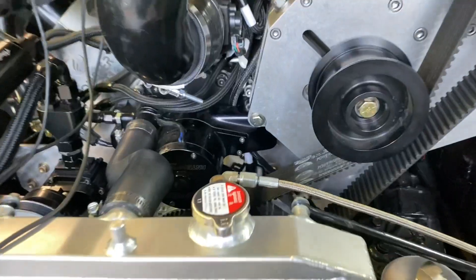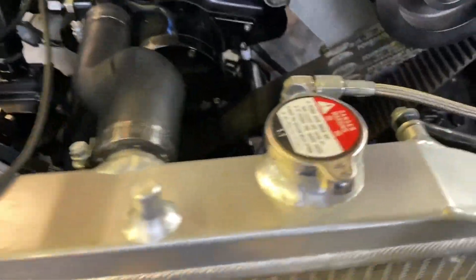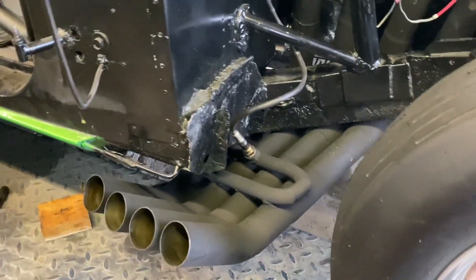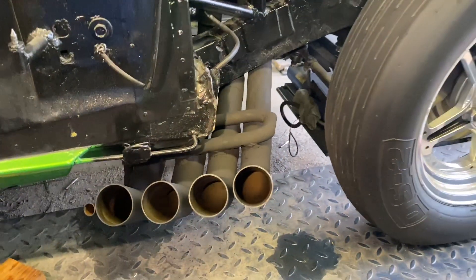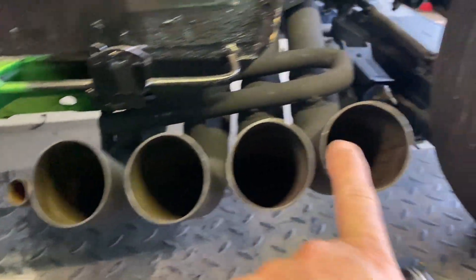We just have to make sure everything's set up correctly. You do have to make some changes in the computer itself as well. The other thing we were having an issue with is the oxygen sensor — it was only in one tube. So Mike built a crossover tube. He's got little stub-outs going down so it'll grab the exhaust. Basically all of these feed through the pipe, go around, turn out, and come back so it can hopefully catch a good reading.